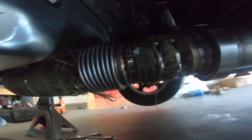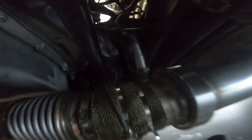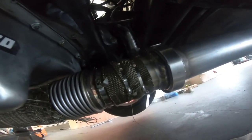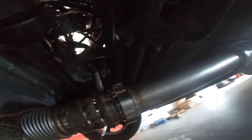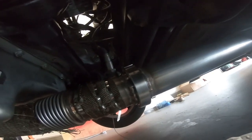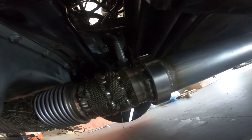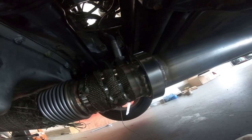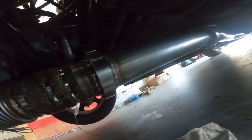Here's the downpipe — it comes with a little flex coupler. Right after the wideband bung, it comes with nothing, just open. I originally welded a three-bolt flange to it matching the style of my thermal exhaust. I put a Vibrant resonator on it to get rid of that Honda high-frequency buzz sound at the top end that everyone hates. When I added the turbo it acted kind of like a muffler itself, but with the resonator on too it made the car really quiet.